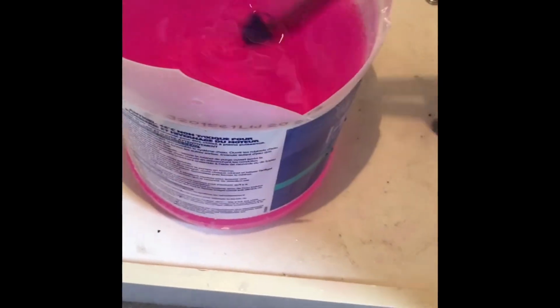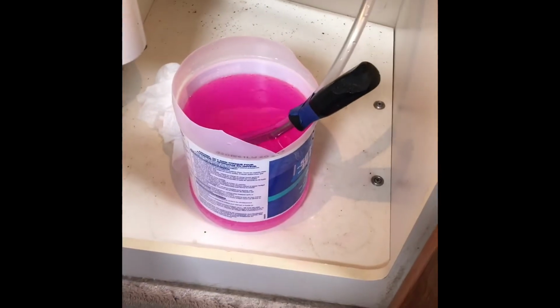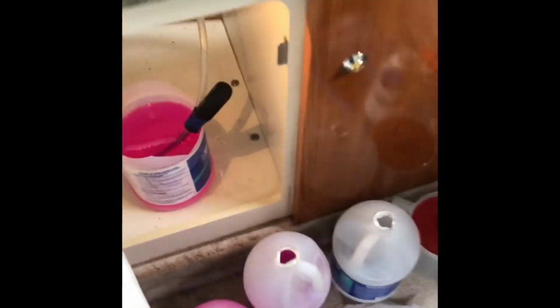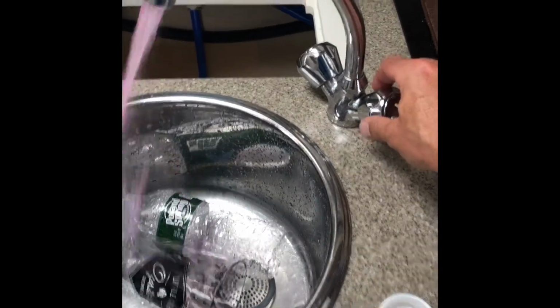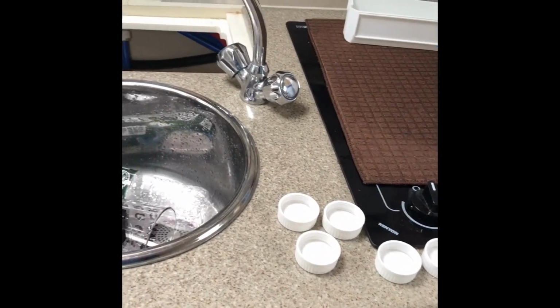So what I did now was I took a long screwdriver and just taped it, so I can put that down there, leave that like that. That way I can turn on the water pump and I can go to each faucet as it pulls it in. So we'll go back, panel, turn the water pump on, and turn the cold water on. And that won't take much to pull it right from in there.